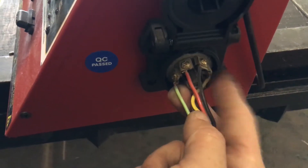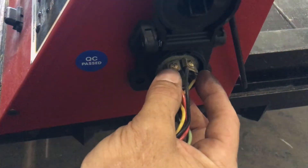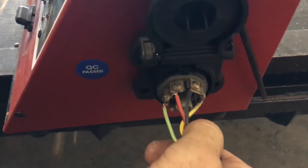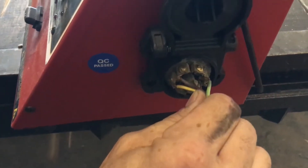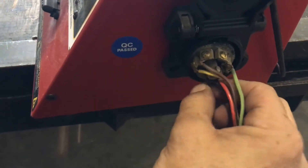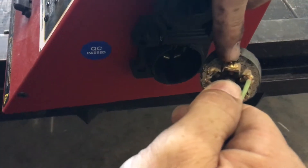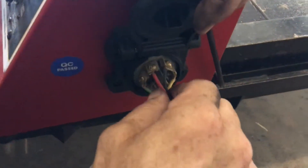This is supposed to be your taillight circuit where my thumb is — that should be a brown wire, but it's red. This trailer is using red for electric brakes. What's happened is this plug is upside down. The correct orientation has brown on the top left, yellow on the left, and ground down here on the bottom post. When you turn it around backwards, there's nothing on the bottom — that's why it's showing open ground.